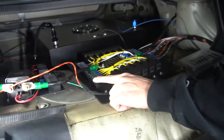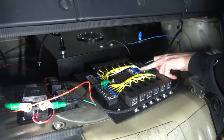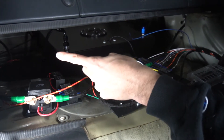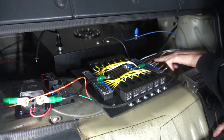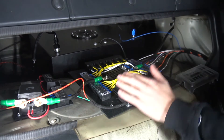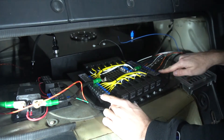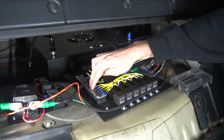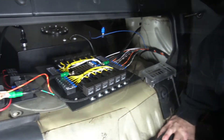When we hit the first click, that gives me power here because it turns on this relay, and that first click also gives 12-volt ignition power to all your switches. We also need to ground it — this runs around to this side and is grounded to the chassis. I also took the battery ground to the chassis over there so we've got a good ground. All of these wires come from our switches in the front. The fan switch comes into here, turns on two relays, and those relays wire out to the two fans in the front.